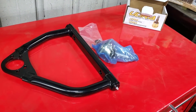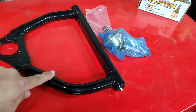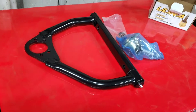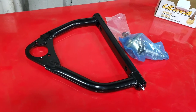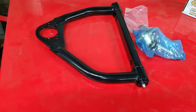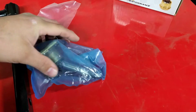To get started on our build, we're going to be swapping the 8-inch arms out for these Speedway motors arms with the steel cross shaft as well — eight and a half inch. The website actually recommends 8-inch for an S10, which in most cases may work for some people, but it's not working on this truck. We're going to go ahead and swap these out to eight and a half. On an S10 forum or a Facebook group — one of the two that I was reading — they also recommended using eight and a half for more adjustability, and we're going to swap to the one-inch taller ball joint.